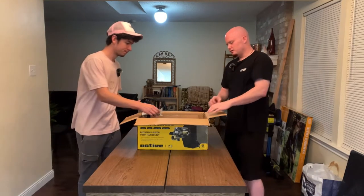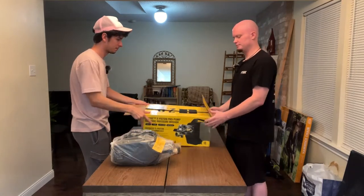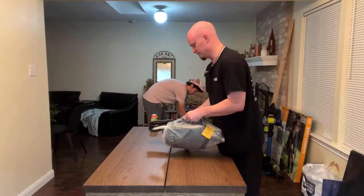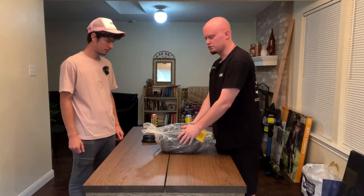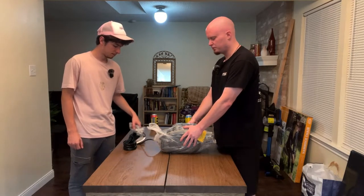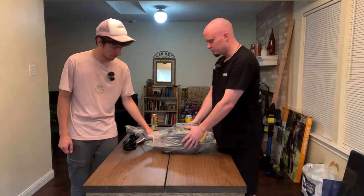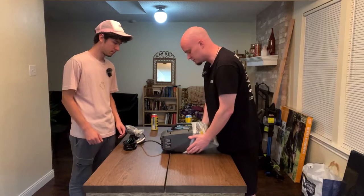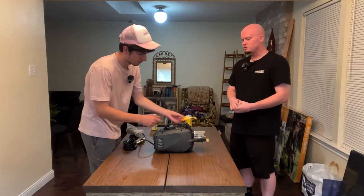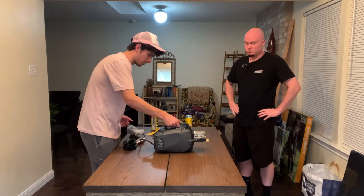Let's get it out of the box. I can't remember the weight — it's not that bad. Not too heavy at all — that's like 20 pounds max. You're going to want a dedicated 15-amp circuit to connect this to, and you don't want anything else connected to that circuit because you want to give as much power to this thing as possible. If you have other things connected to that same circuit, you're going to have a power draw and won't get full performance. Getting it out of the wrapper, that looks really nice — it's a hell of a lot smaller than the Ryobi.